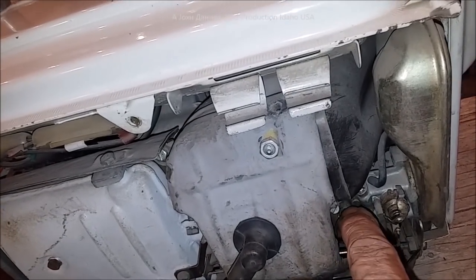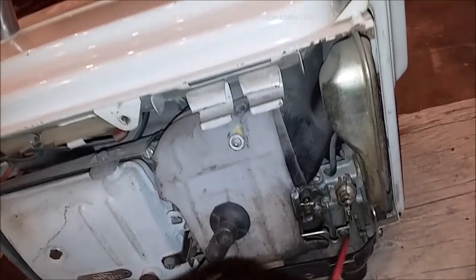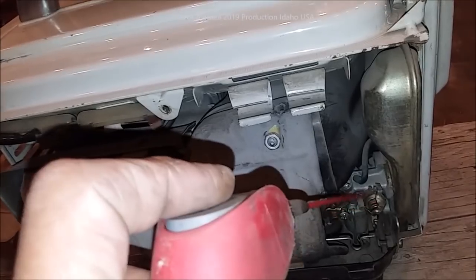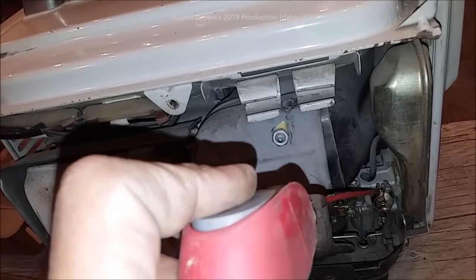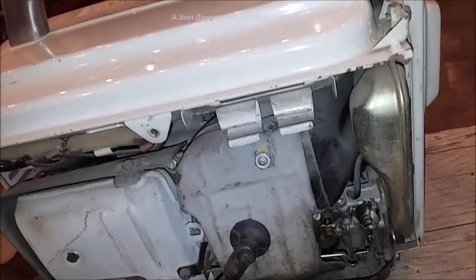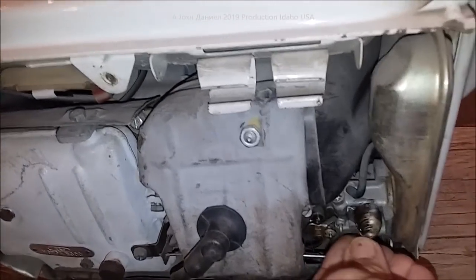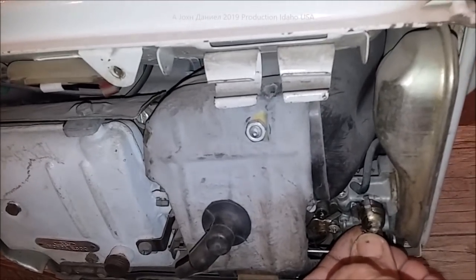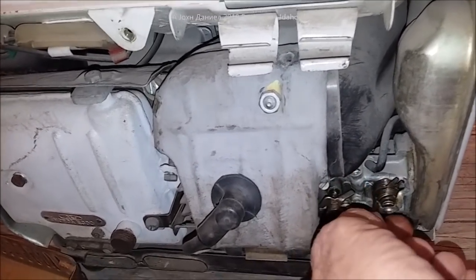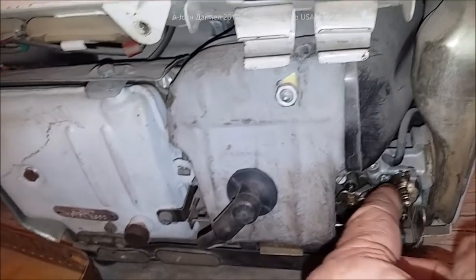Here's what we figured out: there's no movement happening in the throttle. This throttle is governor-based, with a spring that does the throttle, and both of these were gummed up. So I went ahead and took a little WD-40 and soaked it — we're going to do it again right there where it joins in to get it to where it has some movement, because earlier it was not moving at all. We pulled on it and pulled on it and nothing happened. But you can see there that it's starting to move on its own.